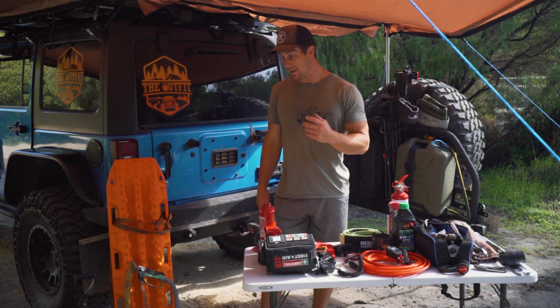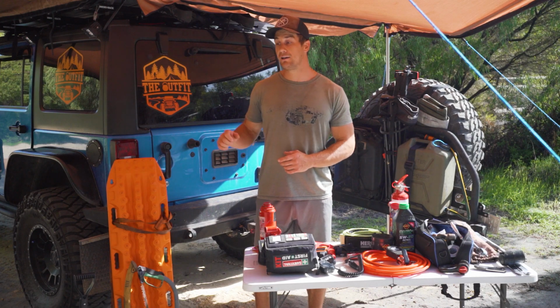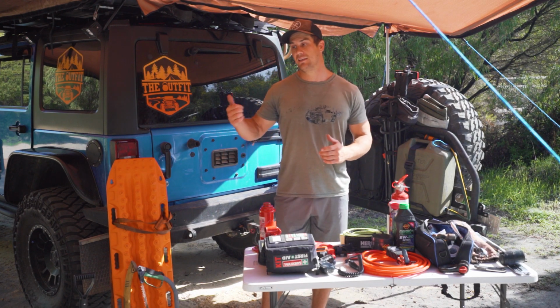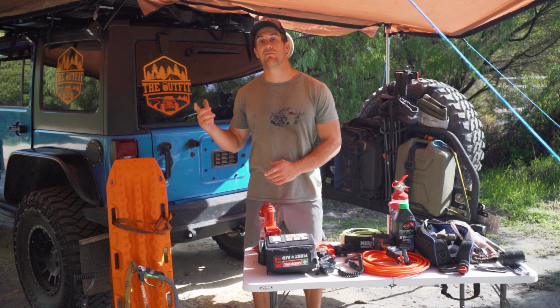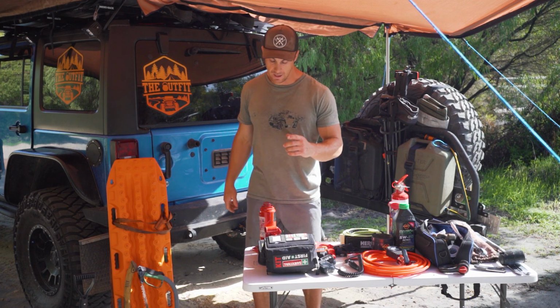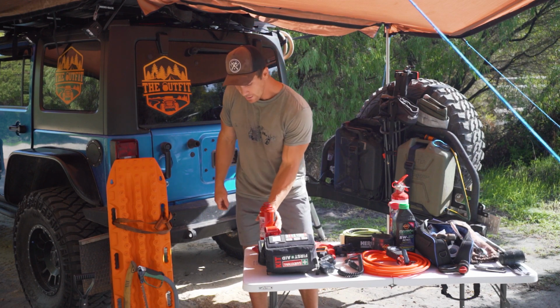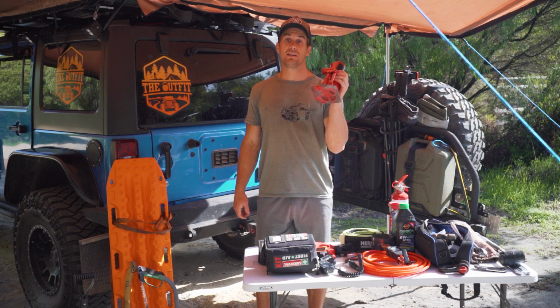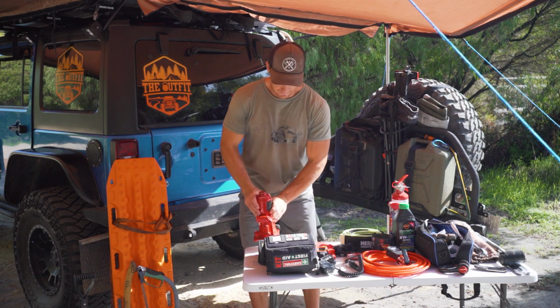Now farm jacks are great, but if you're for instance lifting up the side of your car on a weird angle, that can slip and it will punch straight into the side of your car, or you can smack yourself in the noggin with the handle when that goes. They are really handy for popping a tyre bead, but with a few stacks of wood, as long as you can get this high enough, you can break a bead with this one.